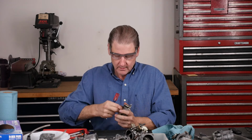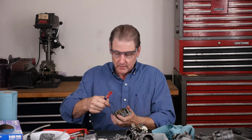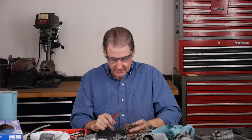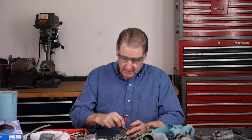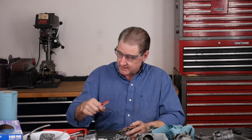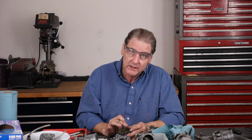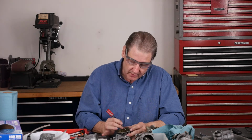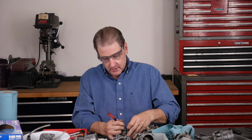Let's see. There we go. So there's two. That also wasn't clear in my tips and tricks. There's this gasket. Let's see if it's swelled much. No. See, there's a Viton gasket. Cool stuff. And then there's a little O-ring around the sprayer, the accelerator pump sprayer, which is right here. And that's got a little gasket too. So we'll get that.